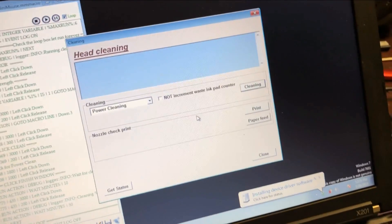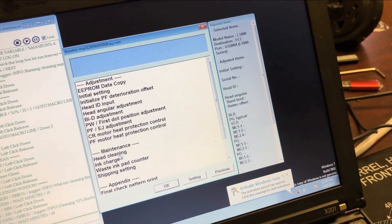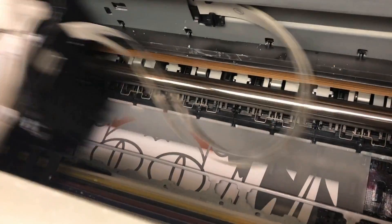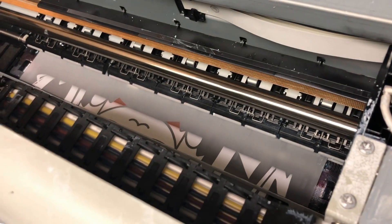I have to go to dinner, so I use an automatic script to do one power cleaning first, then strong cleaning every hour. When I come back, the printer should be ready. I'll put a link above so you can watch how I set up the script, and also in the description. I can guarantee the print head should be as good as new. Look at those pretty white lines — perfect. Basically, every time I set it up it makes me about a thousand dollars. So if I have a guaranteed working print head, I can make money back from this new printer right away.